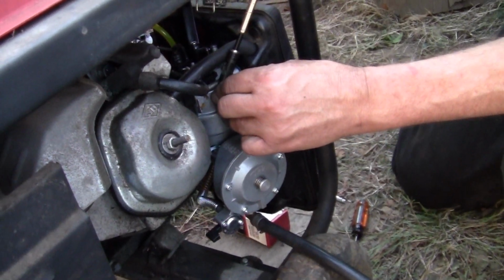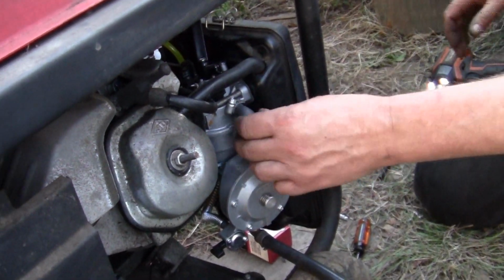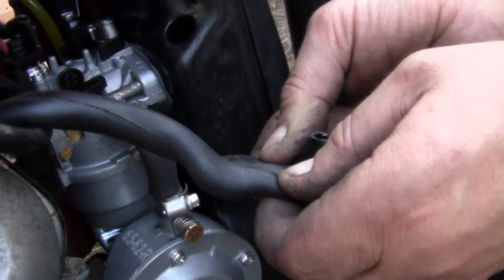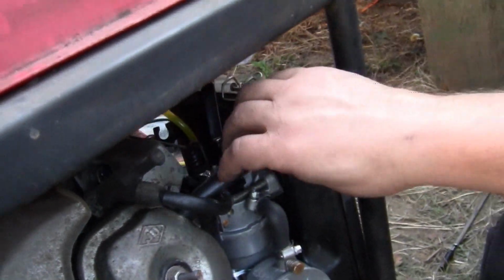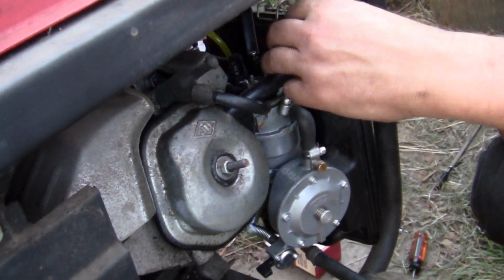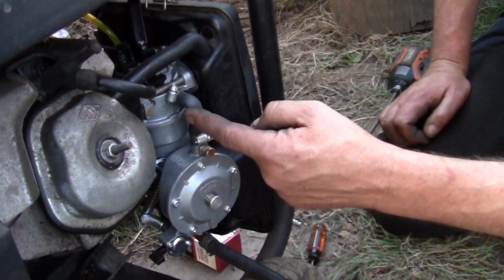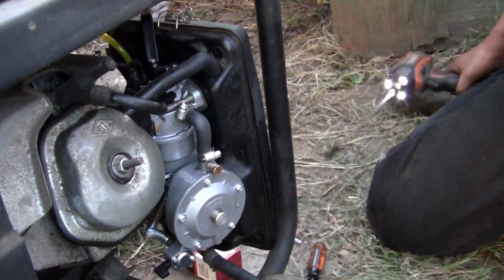All the way up there. If you've got a propane leak, no matter where it is, it's bad. See this hose right here? These are common to go out, and look, it's Jello. It's just junk, and this generator is not that old. I've got to order some of those apparently. At least one, right? All right, so I'm going to leave it in there because it's all I got. But see this hose and your fuel line, it's not oil resistant apparently, right?